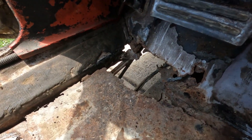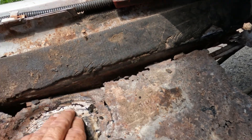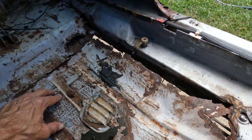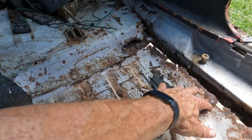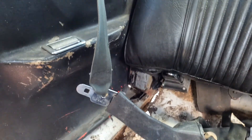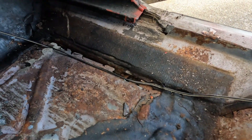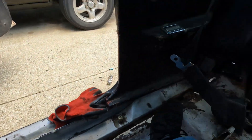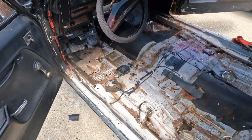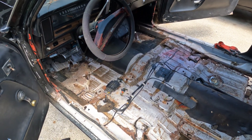Have a look and see what we have to do to get this thing patched up. You've got a hole right here — this panel isn't even connected to the inner rockers. That seems to be a theme that goes all the way back. There's a crack there, a hole there, all the way back there. Pretty much the same thing on the other side. This is a unibody car — this is exactly what you don't want. It's not good. You're going to have to find a way to get all that tack back together. I've seen worse, but I have definitely seen so much better. Midwest car.